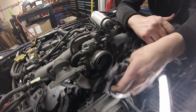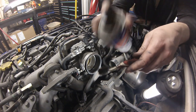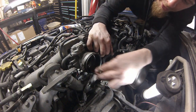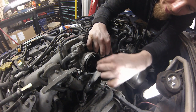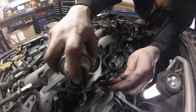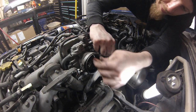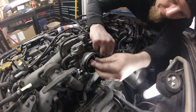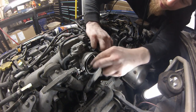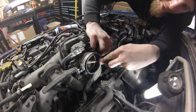I'll take a rag and wipe any of the blown-through oil out of there. So you just take your ex-girlfriend's toothbrush and open up that throttle and just go right around the bore where the plate would rest. This one's not too bad. A little bit more on there — do the top side, a little more, and just go across the edges of the plate. A little bit on the face. The bottom edge — you want to see that shine.